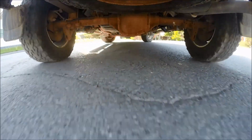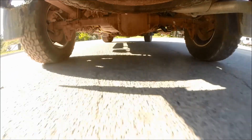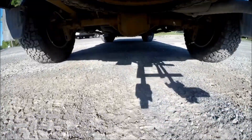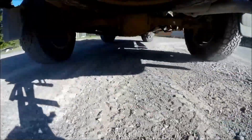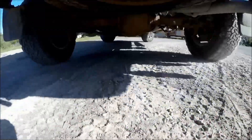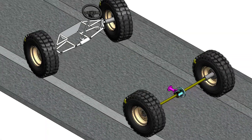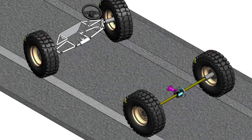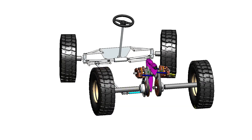What may not be so obvious is the resulting conflict between both tires. The clutch packs create opposing forces to the ground as both tires compete for grip. This conflict becomes obvious off-road and on slippery surfaces — the clutch packs have more holding power than tire grip. The inside tire attempts to drive faster than the surface speed and pushes its way around the turn. Both rear tires attempt to resist the turn; the front tires fight to steer a rear axle that wants to travel straight. This increases the turning radius, creates understeer, and pushes the front tires through the turn. All four tires are fighting each other for grip. A VRD system solves this problem by matching wheel speed in a turn, producing increased traction as both tires deliver equal driving force to the wheels.